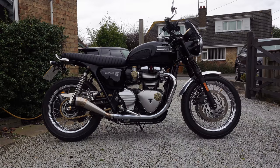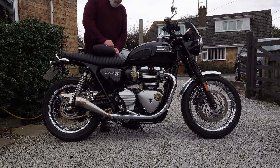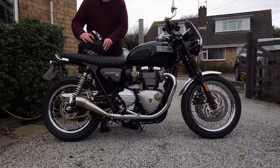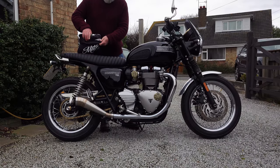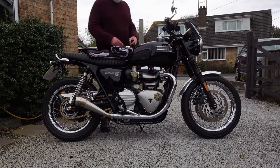The first thing I want to tackle: these are an indoor cover, not a waterproof outdoor cover. It is a really bad idea to cover a motorcycle indoors with a waterproof outdoor cover between autumn and spring, especially in an unheated environment, because condensation builds up on the cold surfaces of your bike and the cover holds it there throughout autumn, winter, and spring, which accelerates corrosion. That's why manufacturers design specific outdoor and indoor covers - right tool for the job.